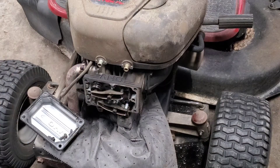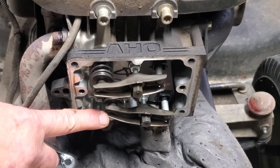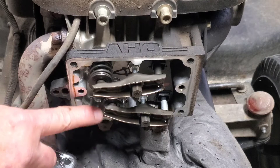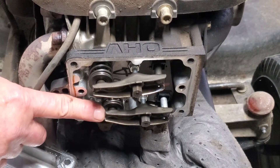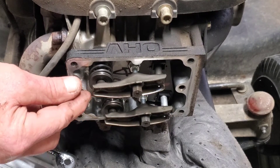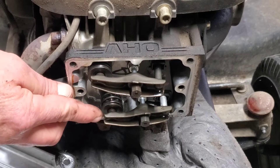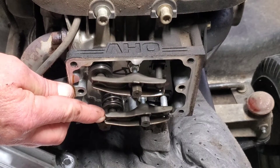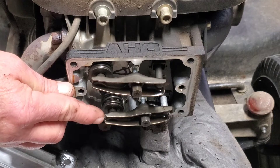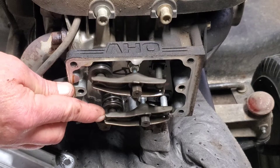What I'm going to show you is how to see if your camshaft is bad. The way you check is we're going to watch this rocker arm. That valve right now is open, it's coming closed, and there is a bump in there. Just keep going around — I'm spinning the engine by hand. There goes our exhaust valve opening. Watch this valve. What you're looking for is a little tiny bump. If it does the tiny bump, that means your camshaft is okay.